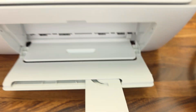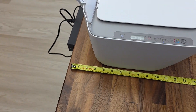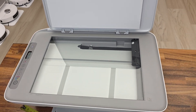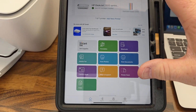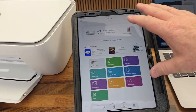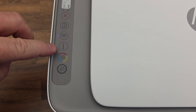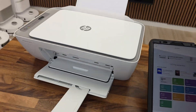It wants to print a test page — it says printing in progress. Paper's loaded and it is printing. Now let me go over some quick measurements. Front to back, since the paper sticks out the back, you need about 21 inches but only a 9-inch platform. Left to right it's about 17 inches. You do have to lift the lid — the lid doesn't come off — and height-wise you're going to need about 15.5 inches. After connecting Wi-Fi and setting auto upgrades, it's going to do an update, so let it sit for about 15-20 minutes before trying to print.